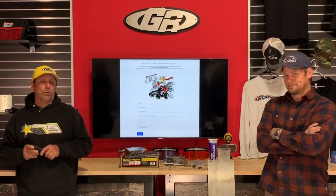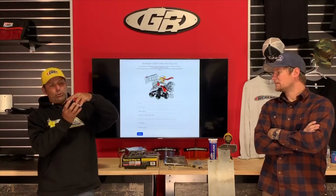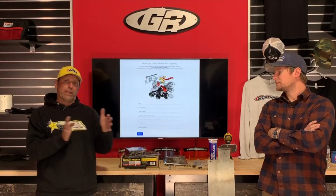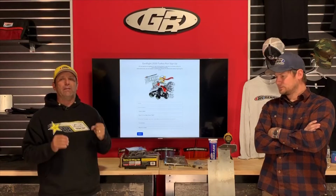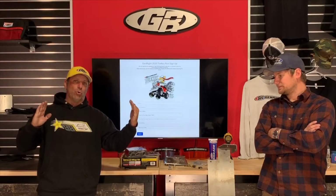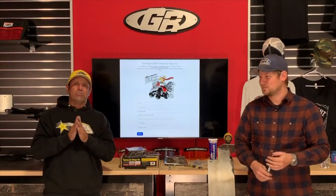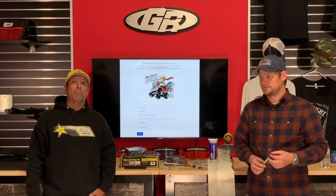Right, yeah. So when you go to a coilover, one of the big advantages is that you put the springs straight over the shock. Right now on your Jeep, the spring and the shock are working in separate planes, where on a coilover, they're working in one plane. A lot of the time that allows you to move the spring and dampening control out toward the wheel, which stabilizes the vehicle a lot more. If you look at any of our suspensions, you'll see that we've moved those out as far as we can, and the vehicle feels completely different.